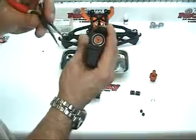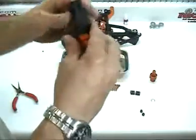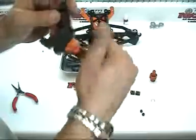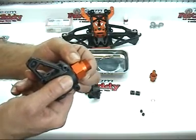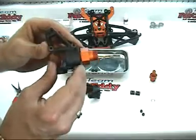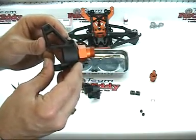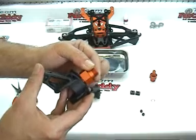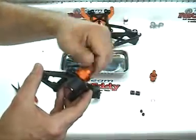What you're going to want to do is hold on to the hub and rotate it, making sure it's on and in that groove just the way you want it. Let's go ahead and test it — we can see that the bearing runs nice and smooth. One thing I look at is that there is an amount of play that goes in and out. What I'm going to do — in a separate tutorial — is that Team Fast Eddy offers a shim kit. That shim kit has 30 separate shims: 10 of each size — an extremely thin, a medium, and a thicker shim. We're going to stack those shims on the inside so that there is a minimal amount of play without it binding up, and that'll actually help prevent it from coming apart and falling off later on down the road.